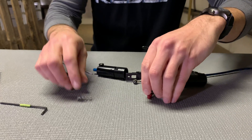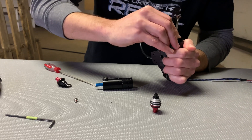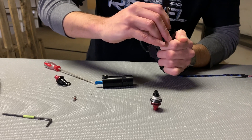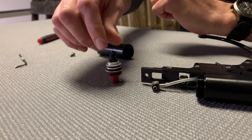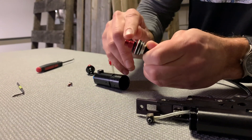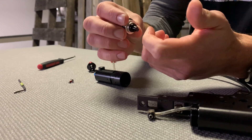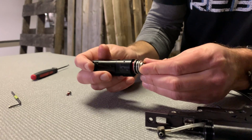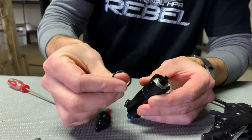So to install the new valve, spring goes back in first. To install this, grease the very front tip of the stem, this shoulder right here, and this seal o-ring. You don't need to grease the other o-rings here — you could to make sliding a little easier, but usually it's a pretty good fit so you don't have to. Then just drop it right into the center cylinder. It pops in. You don't need to put the retaining ring back in — you don't need it anymore. Leave that out, and then just screw this into the rear cylinder.